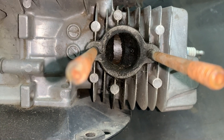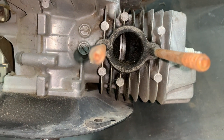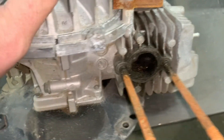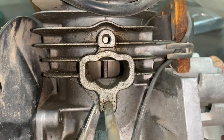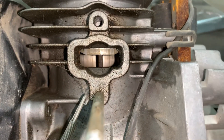Carbon will clog that hole up, and your exhaust ports will get clogged up. This engine's done — it's already had dirt ingestion and I think it only had like 35 pounds of compression. Here's the intake side of the piston, the piston skirt, underside of the piston.